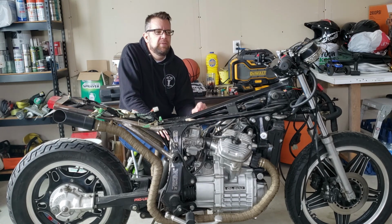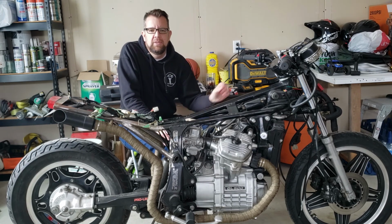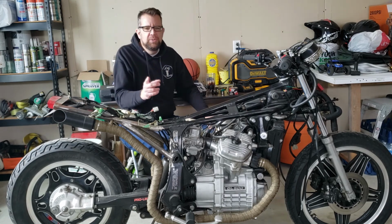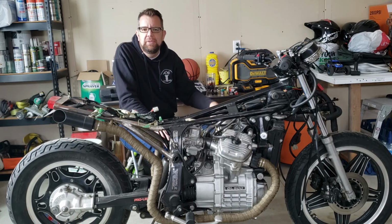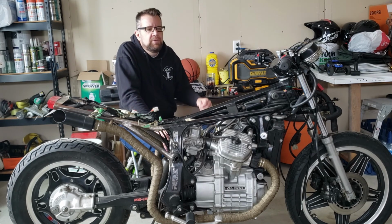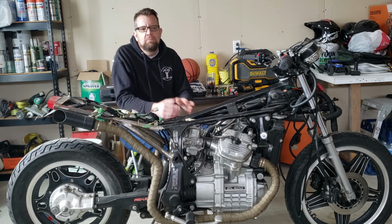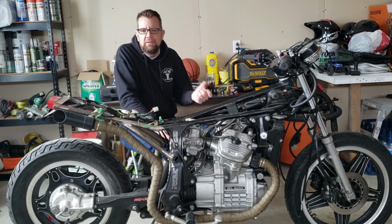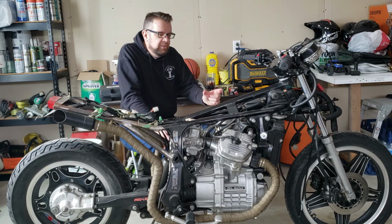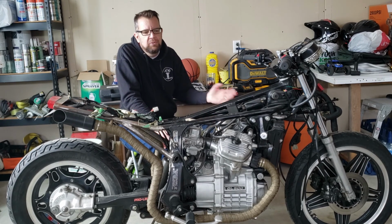And here's the issue that I'm having. I feel like I've run out of the adjustment travel with the clutch lever on the top and with it on the bottom. But here recently I've seen I might be doing the bottom incorrectly. So since we're gonna have the oil out, I'm still gonna take a look at probably just as deep as the springs. The springs that hold the pressure plate on, those have a serviceable life. So we'll take a look at the manual and see what we're having in just a rested state and see if we're within tolerance. And if we are, great, we'll put it back in.